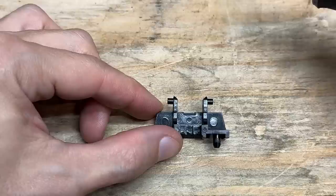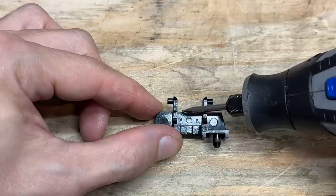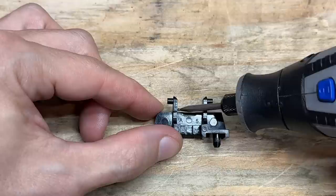I've got that CPU bracket temporarily held together with super glue. Now if I'm going to have any hope of preserving that folding action, I'm only going to be able to reinforce these on the inner portion. So what I'm going to do is Dremel a groove down the middle of each side and fill that with epoxy. Hopefully that'll give us some more structural integrity.